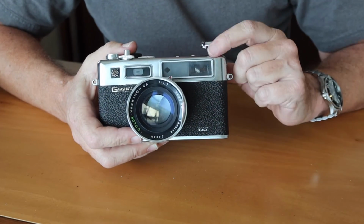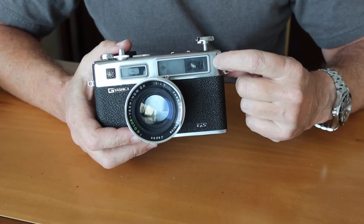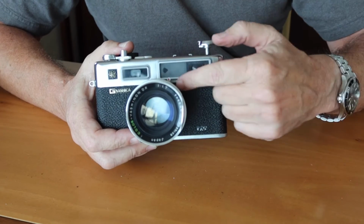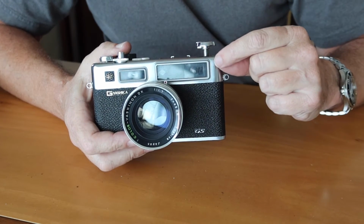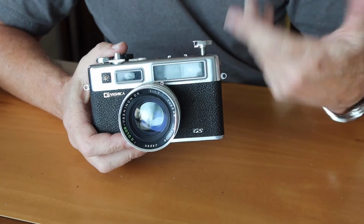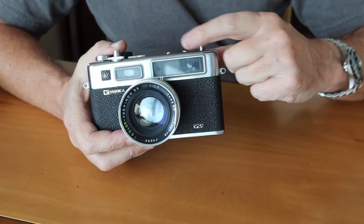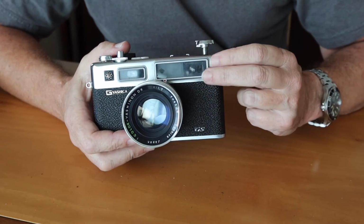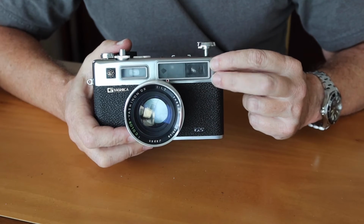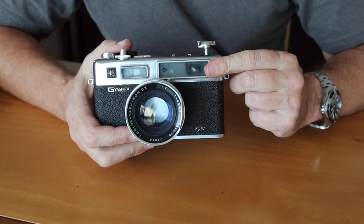On these cameras, this is a little more tricky to do because when you remove the top cover, there's a little metal clip. You have to pop that off, and then you have to pull this out because it's glued in a little bit. Then you have to take out a small set screw to separate the front bezel and rear bezel. Then you take out the glass and clean it. Then you put the glass back, put the bezels back together, slide it back into the front of the camera. Then you have to really play for a while to get that little metal clip back in because it doesn't like to go back in easily. And then you have to put a drop of glue on the clip to make sure that it doesn't come out.